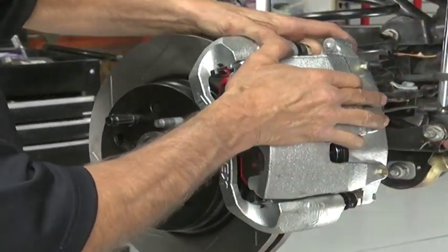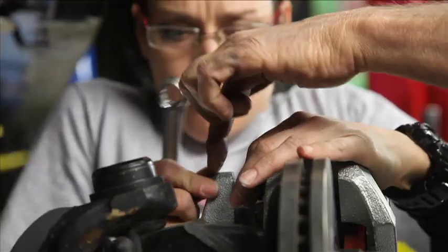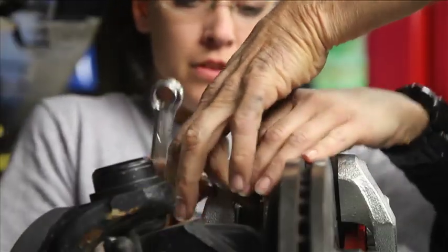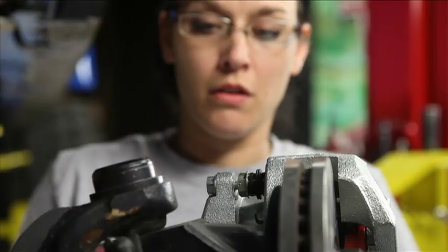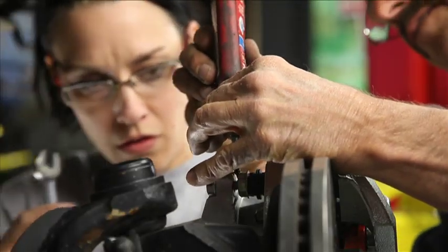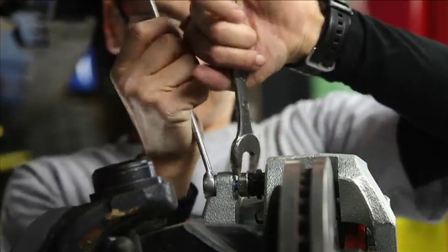There are little clips that are an index for the pads — you're going to need to work those pistons past them to get the caliper on. All we need to do is re-tighten that caliper mount bolt. This can be tricky because that bolt has got so much Loctite in there sometimes it's hard to turn. Once you've got it started, just go ahead and run it tight. We do not want those bolts coming out — these are brakes.